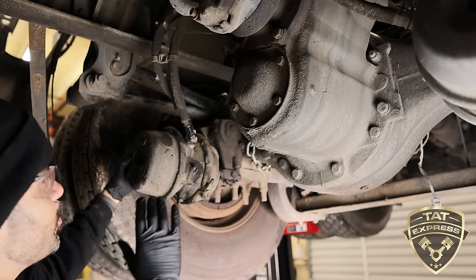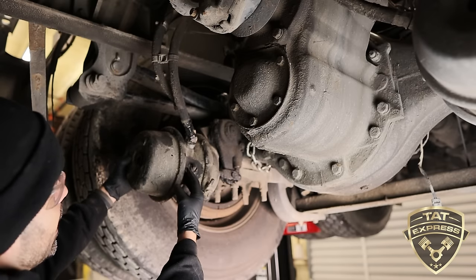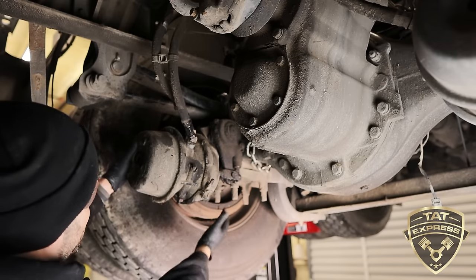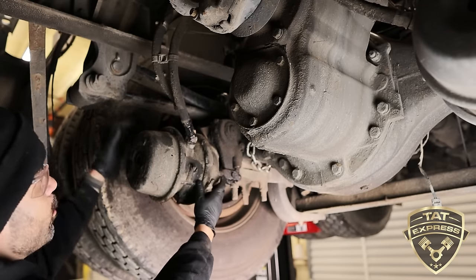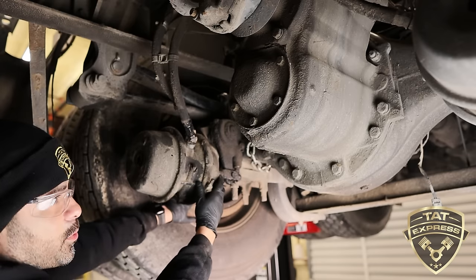And once you push your yellow button, air comes into this hose and the diaphragm on this side gets pushed and compresses this spring, and of course drives your push rod back and releases your brake. This section of the brake chamber has a separate diaphragm. When you hit the foot brake, the service brake gets applied, and that's how you get brakes.